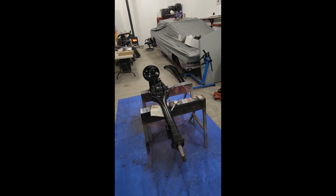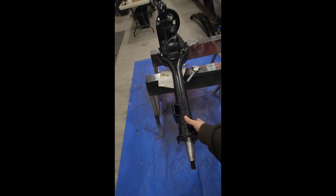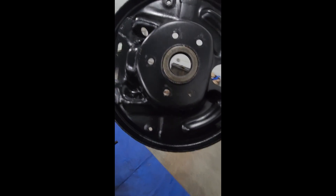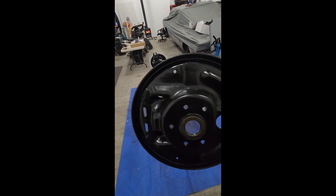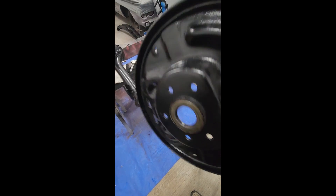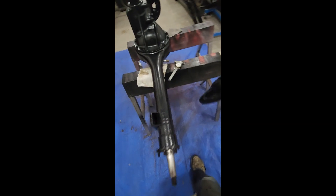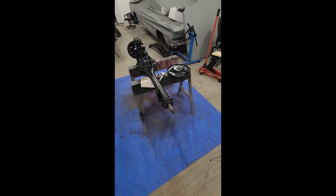There we go — they're both in. The bearings are set, I've got my spacers in here, backing plate on, bolts torqued to 45 foot pounds. The original seals were actually like styrofoam on each side of the shims. The new and improved ones that go against the backing plate — they're metal, stainless steel, with a kind of rubbery velvety coating. They're supposed to seal a lot better to the backing plate. The flat surface seals fine to the axle. I bought four of them, two for each side. With the coating they became thicker, so I had to figure out my end play.